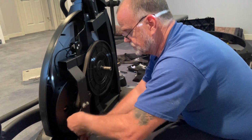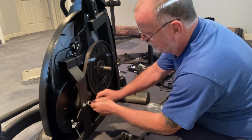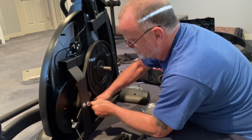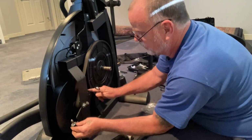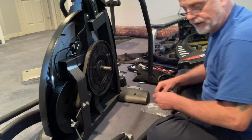All right, I should be able to work with that. It's a 1/2 inch also. Yep, it is good. So we got to loosen this up just a little bit so that the tensioner will move, because we're going to need, say the tensioner went all the way up after I did that. So this is now flexible.